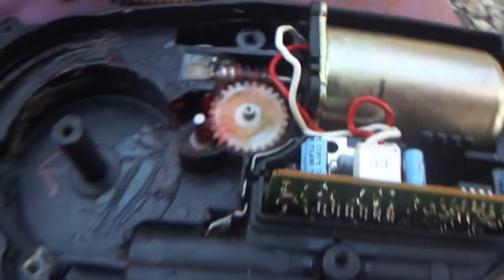This is pretty basic stuff. When you take it out, this is the base gear here which is obviously driven by the worm gear. You have this container here with the actual little plastic teeth sitting in it, and then you have the actual container, and this just goes on top. Watch that DIY video — before you start getting this out of the car, I would suggest you turn the radio on, get the antenna extended, then pull that connection. When you're putting it back in, feed this beast in, making sure this is all clean. In my case there was a piece of plastic tubing in here that obviously helps for this thing to be driven down there.